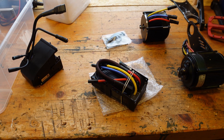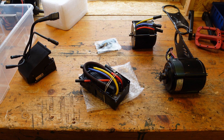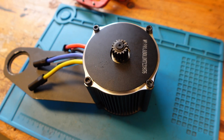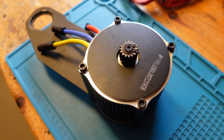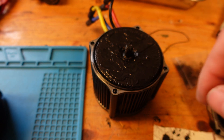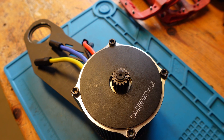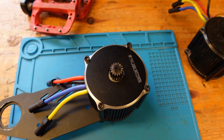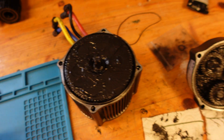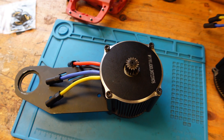That's all about the components — I'll start disassembling, put the new elements in, and then mount it on the bike. You can see I've put the sprocket back in place on the new motor core. Remember to install the small locking piece before you put the sprocket, and then secure it with the circlip. After that, just apply this black grease, smear it all around, and then put the gearbox back in place. The job is done — it's very quick.